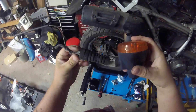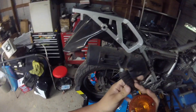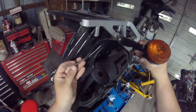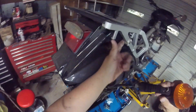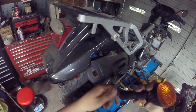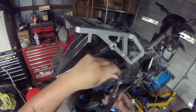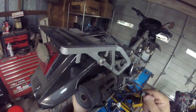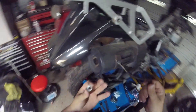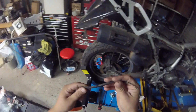I've already taken this one off, but here's what you're usually working with. It takes a 14 millimeter nut. On the bike, front and back are kind of the same situation - take this 14 millimeter nut off. It'll be right behind the rack or right inside your front fairing. Take your 14 millimeter wrench, loosen that nut, unhook the wires from under the fender, pull those through, and take it off. You don't need the old nut.